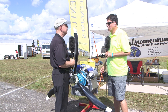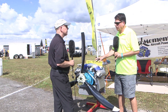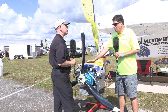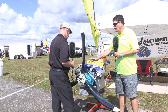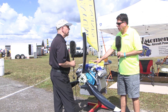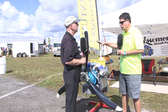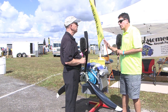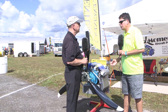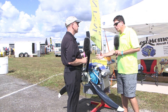We have the 1,300 — the AM13 — and the 1,500 — the AM15. Either engine can be done slanted or upright. The slant configuration is something Suzuki already supports, so we didn't take an engine designed only to operate vertically and slant it over — we took one that can operate either way. There are minor differences in baffling, oil pan, and oil pickup between the configurations, and we utilize those changes when we do the conversions.